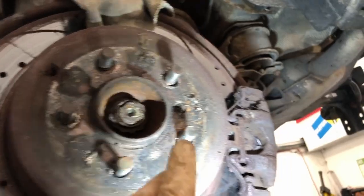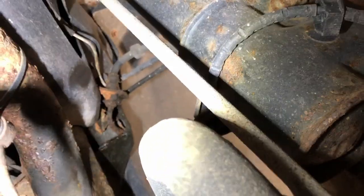The underneath — all of this area — I've got to go and get some more treatment because I've run out. I've got to wire brush this side, take the caliper apart, do the handbrake like I did on the other side, wire brush all this down, all under here. I'll probably give the brake pipes just a coat of matte black paint for a little extra protection since it's all going to be covered up anyway. And that one up there looks pretty horrific.